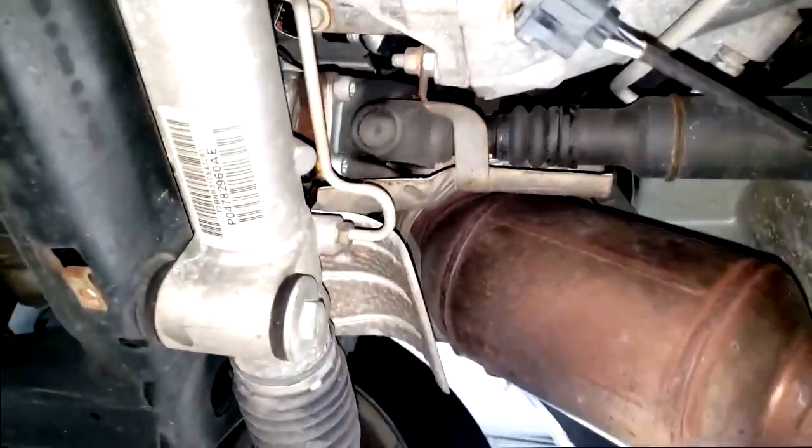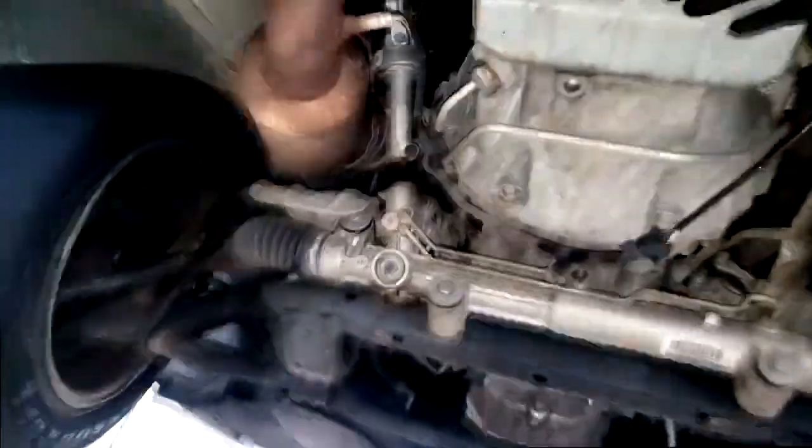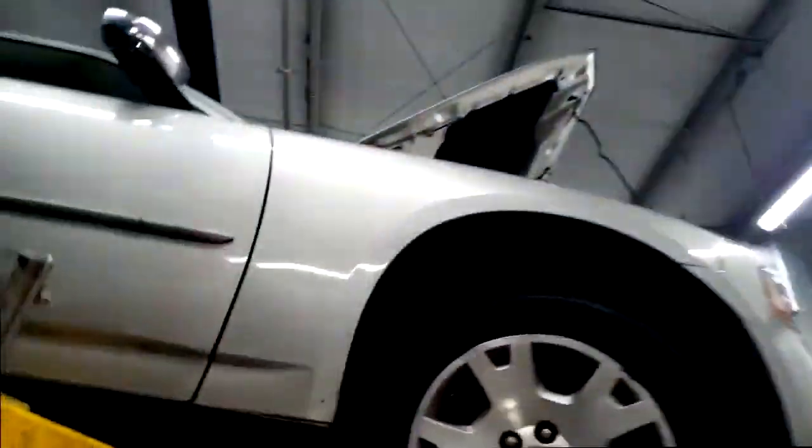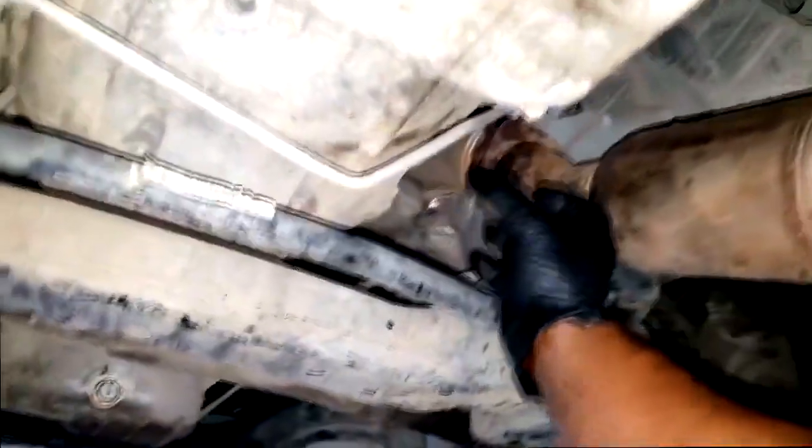I've got a couple of subscribers with these all-wheel drive 300s. I'm no big fan of all-wheel drive - just too much stuff involved. They had to mount this rack on the rear side of the cradle because of the way to get access to the front. It's a NAG transmission. On a charger without all-wheel drive the suspension is the same, but on this car all of this area is filled up with an axle and a PTU to accomplish that all-wheel drive feat.